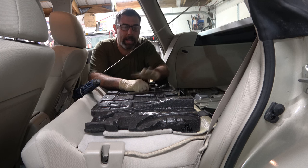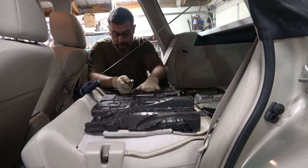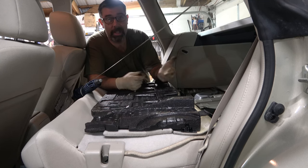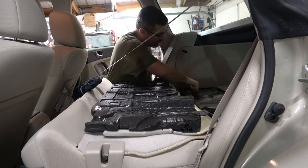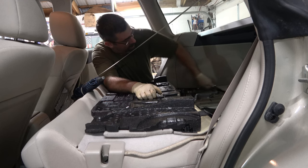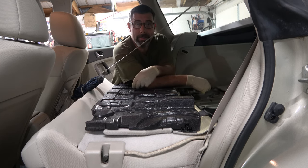Here we are in the back of the Outback. We fold this piece of paneling here up and over, fold the seats down — you don't have to disconnect anything really, just kind of wiggle it out of the way. And that exposes these — there's one right there and one right there. It is a 14mm ratcheting wrench that I'm going to be using to get these out of here. It's a little tough to get it over the side, but you don't have to take all this stuff out. I'd rather not take apart half the interior if I don't have to.